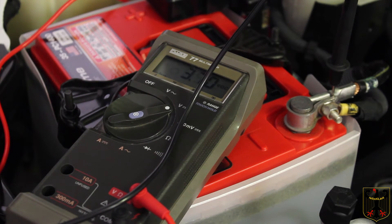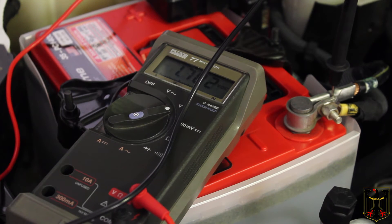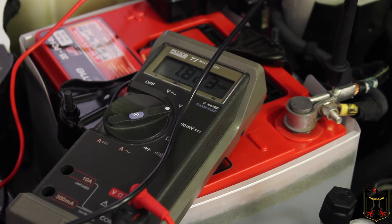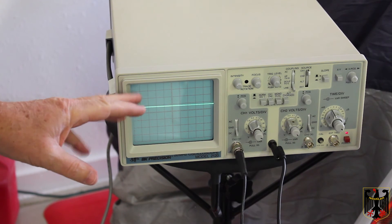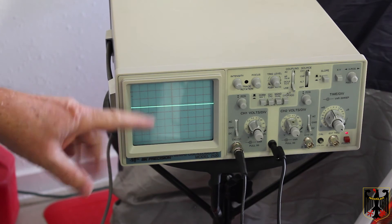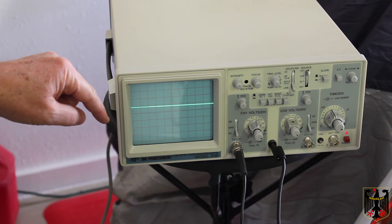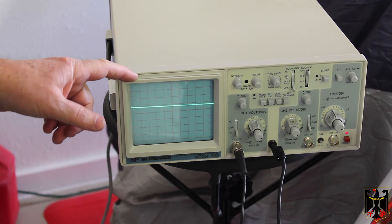With no start I have a voltage reading of 3.7V, and with high idle it's about 1.8V. After stopping it, I plugged in the oscilloscope. Running it and looking for weird waveforms, I haven't seen any. I keyed it on without starting and there was nothing unusual — well, actually there is something unusual: the Stillen piggyback puts out a higher voltage than expected. It doesn't match the input from the mass airflow sensor. However, when it's idling and running it seems to be okay.